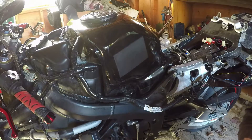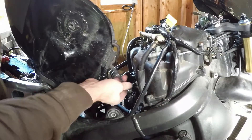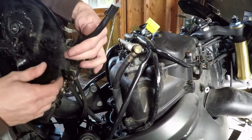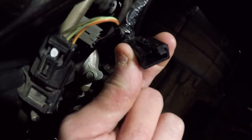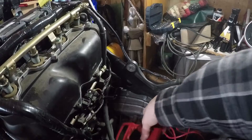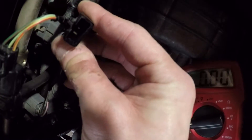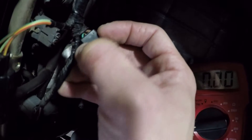Now we're going to proceed. So when you lift your tank up, right in there is this power cord. You want to unplug this — it's just a clip wire. And you just want to unplug that — that is to actually power the fuel pump. And that's this plug right here which attaches to the bottom of the fuel pump. So you had those unplugged. You're just going to take your multimeter, turn it on, set it to read volts. The actual part of your wire harness that you unplugged from your fuel pump: brown is negative, green is positive.